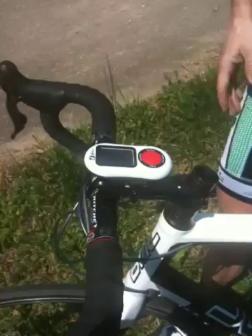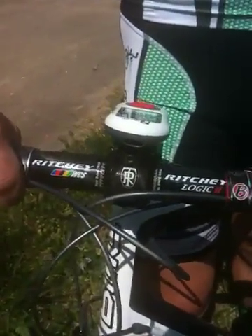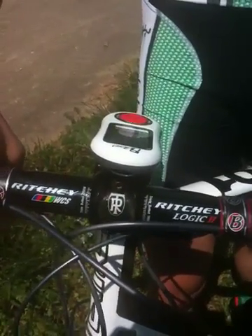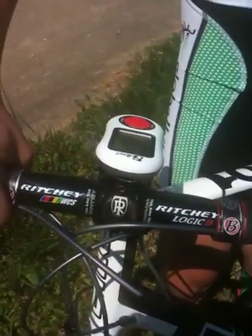Now, how does it do all that? Well, it has a wind port on the front of it, and it measures how much wind you have coming in, so it knows whether you're riding in a headwind or a tailwind. And then based on your weight, your drag coefficient, and whether you're going uphill or downhill, or how fast you're going, it can figure out the wattage you need to overcome this very accurately.